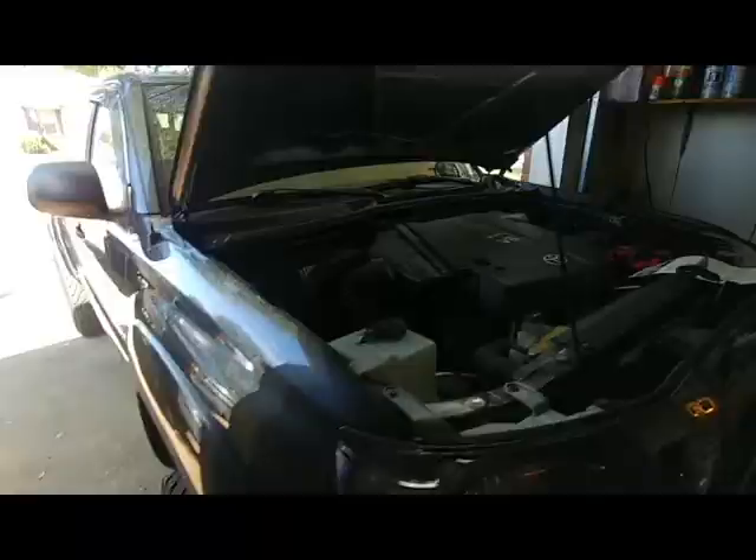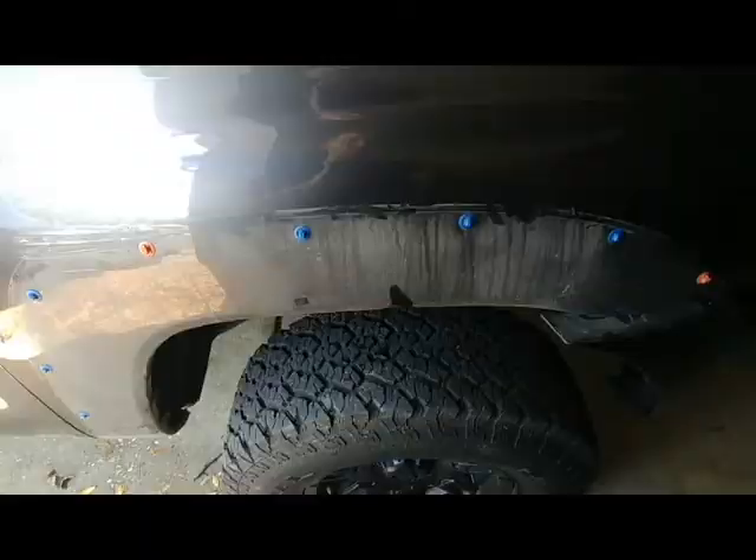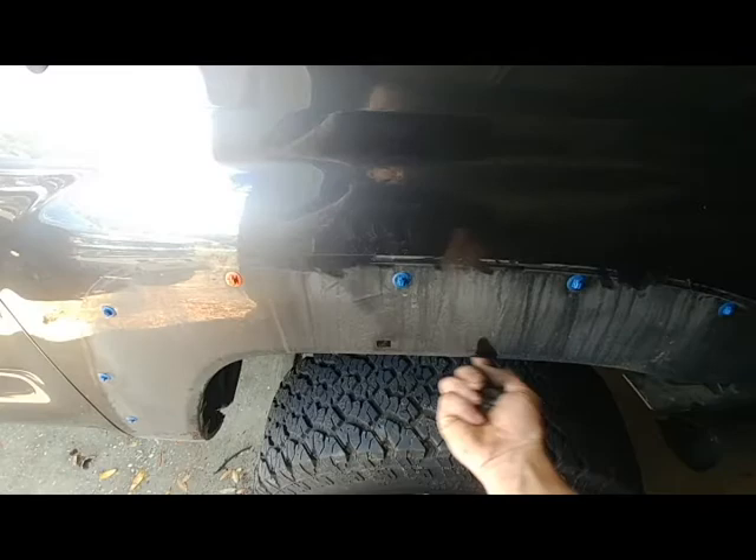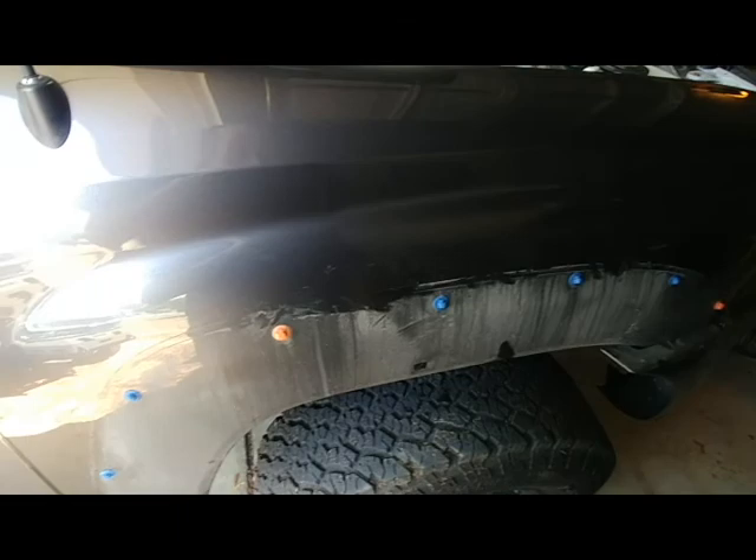The first step is to get all these little plastic things out — and damn, these things are a pain to get out. To get the inner fender out so that you can route the piping up under here, and then you have to get your inner fender flare off, which every single one of those little clips breaks when you do this. There's also some 10-millimeter bolts in here. With that out, you can clearly see the intake, and then everything routes up in there.